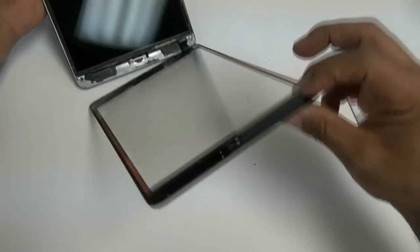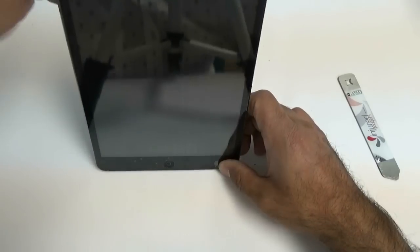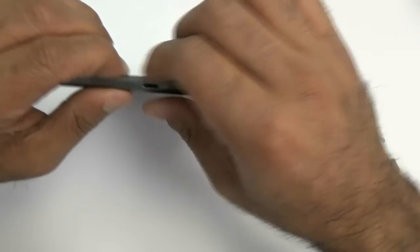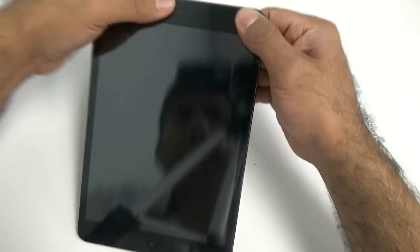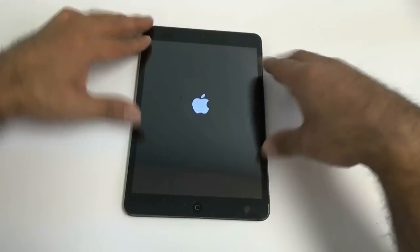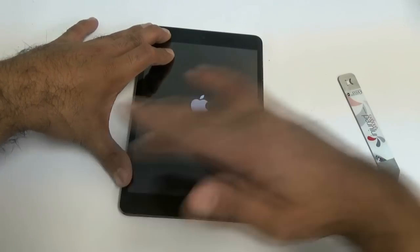Go ahead and put your touchscreen in place — make sure it's lined up properly. Then you can go ahead and power up your iPad mini. Test out the home button, the power button, and the slide unlock button. Make sure it's all working before you do anything. Please note that if the sides of your iPad mini have been bent in from a drop, your glass may not sit properly. You'll want to bend those out. We carry a corner tool called the Plier Tech on our website, or you can use a hammer and a screwdriver. For all your parts and tools, check us out at injuredgadgets.com. Please like us on Facebook and subscribe.